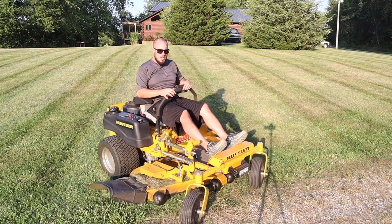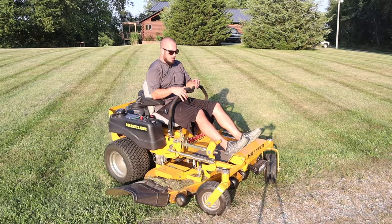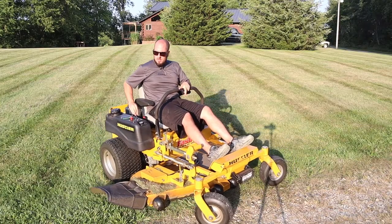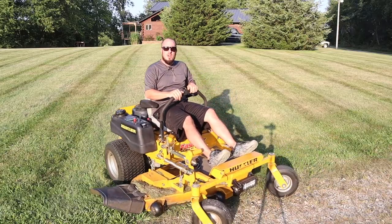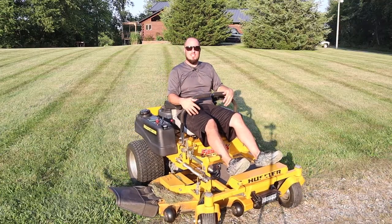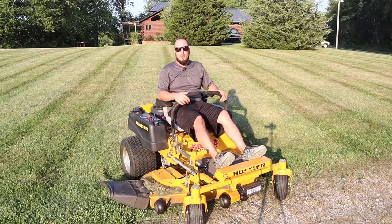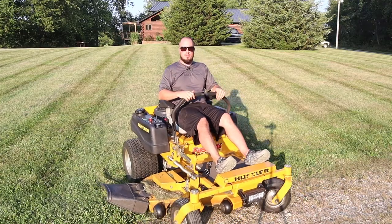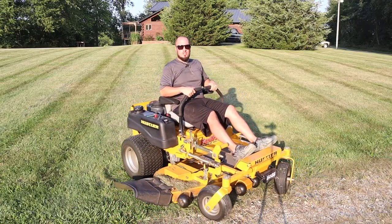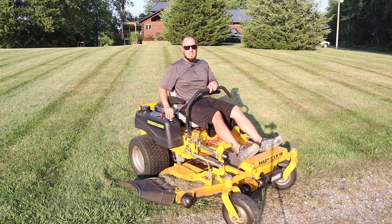After a little bit, you'll get used to it. The most common mistake I see is people just throttle up right away — they're ready to go. The higher you go, the more responsive it is. Those same movements you made at idle are a lot crazier when you have it throttled way up. The number one tip I have is to keep your hands free, just sitting on the arms. When you go over bumps, you want your hands to move around the arms rather than having a death grip. Keep it loose, keep it relaxed, and when you do throttle up, you'll make nice fluid movements.